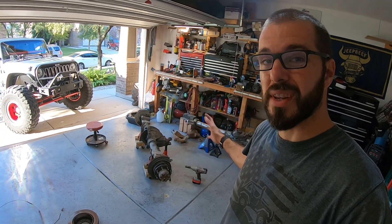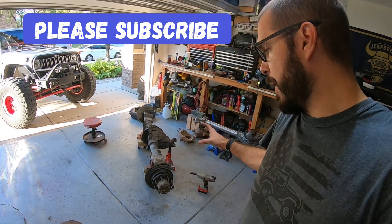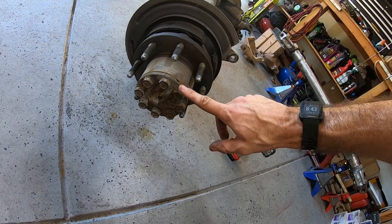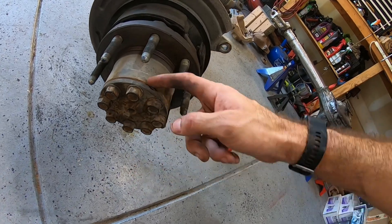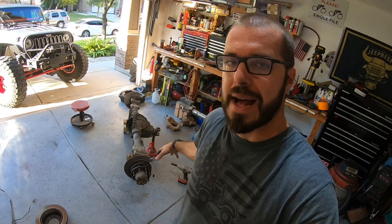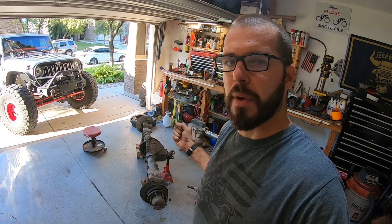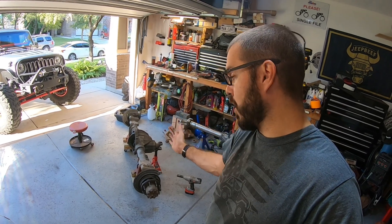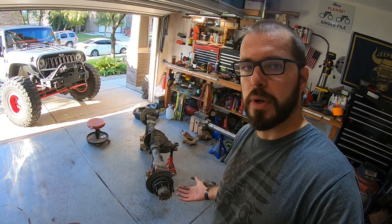At this point, this axle is pretty well broken down — it's a lot simpler than any front axle, certainly the Super Duty. We're going to be moving on to remove the axle shafts. The way these remove is with these bolts all the way around — they should be three-quarter inch. Hit them with your impact gun and then break the seal; sometimes there's a gasket, sometimes people use RTV. Be ready to have a little bit of fluid drip out, and those axle shafts should be coated in a light film of it.